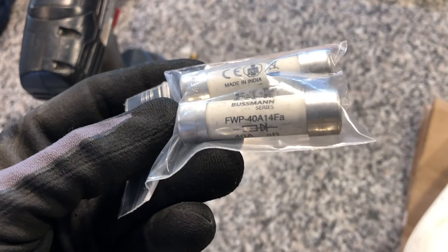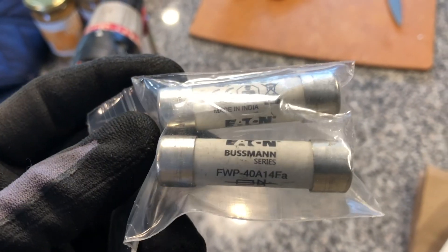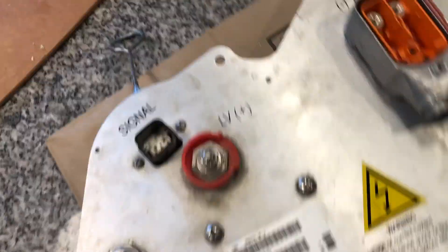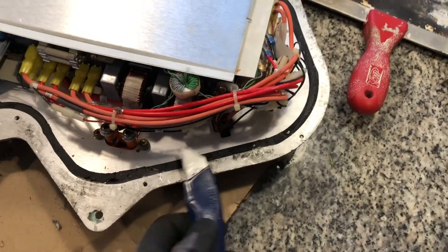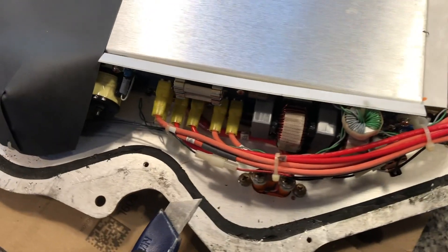I've got my fuse here — I got two but I'm just going to put one in. The part number is FWP40A14FA, and I picked each up for about $17 on Amazon. I'm wedging the converter open using a couple of paint can openers to help wedge it apart and keep pressure upwards, separating the two pieces of metal so I can get my knife in there. Gradually I got this apart using mainly a utility knife angled in. It works really well at a length where it can reach in to break the gasket but not so long that you'd cut the wires — some people who've done this job warned me how close some of the wires are to the edge, so you really don't want to go too deep.